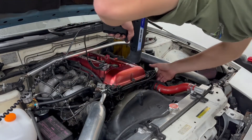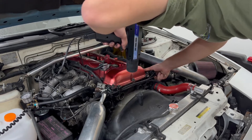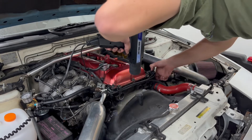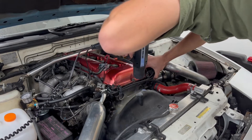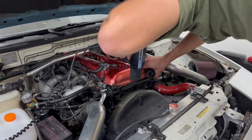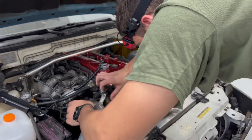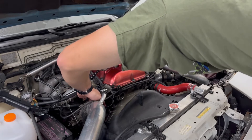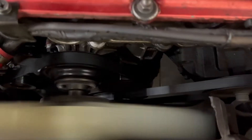The engine was a good bit retarded, which was my first point of confusion. The further left on the hash marks that we go, the more retarded the timing is, and the further right, the more advanced it is. You can see that as I turn the cam angle sensor, the idle is changing up and down and the timing needle is moving left and right relative to the hash marks. I unplugged the throttle position sensor when I did this because that's what someone said online. I also saw a video where to get it into timing mode, they're supposed to rev the engine three times over 3000 RPM, but I didn't do that. I'm really just kind of confused on the whole process and whether I even did anything permanent, because I went and double checked the next day and it looks like the timing is set back to almost exactly where it was before.